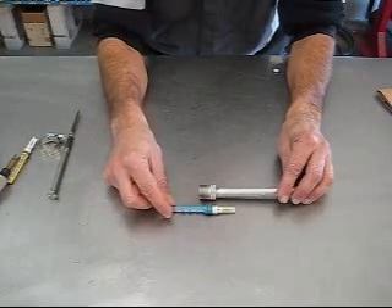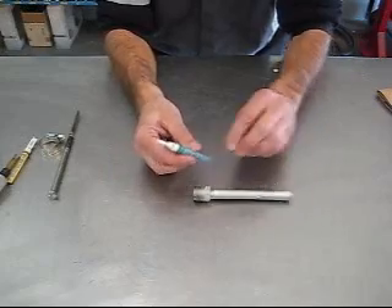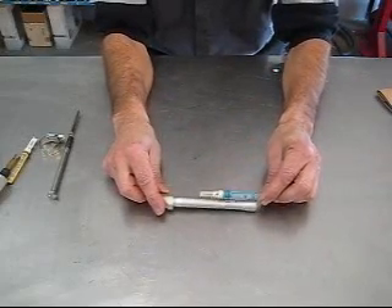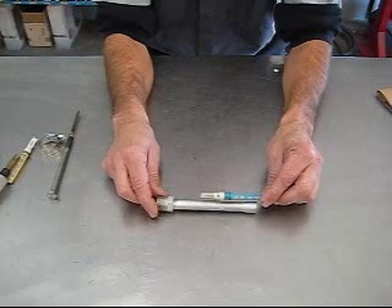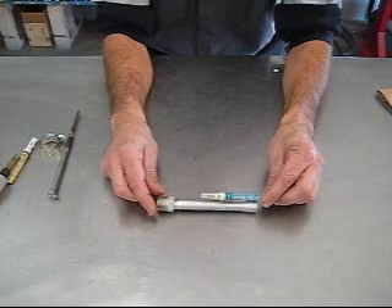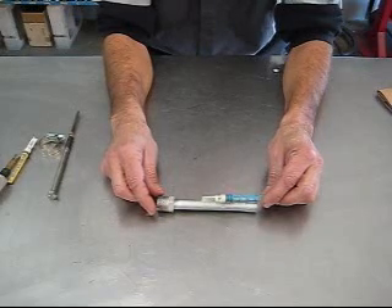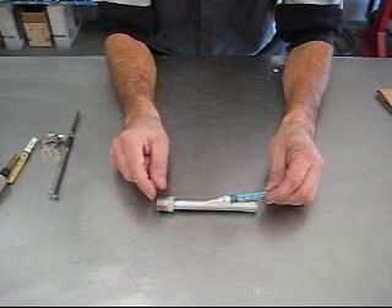What we see are these things installed backwards. And when they're installed backwards, they will slide past those little dimples in the tube, go down too far, get caught around a corner, making it nearly impossible to remove. Also creating all sorts of different performance issues — pressure is not right, and the little short screen will block up.